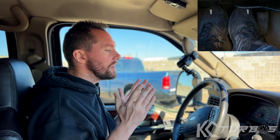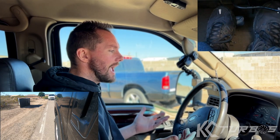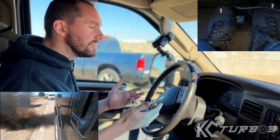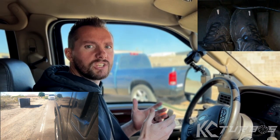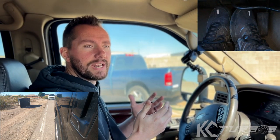I'm gonna show you what not to do. What a lot of people do is they just get in and mash the pedal, and when you do that it just smokes a lot and takes forever to come up. With smaller turbos you won't notice it so much, but with a bigger turbo it's gonna take a lot longer to light, and it'll be a lot harder to get it to light.